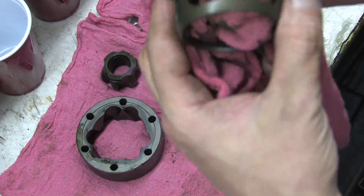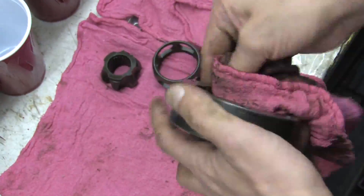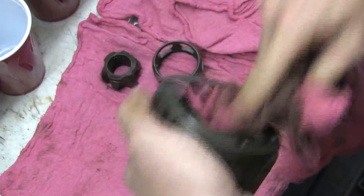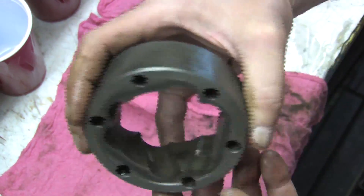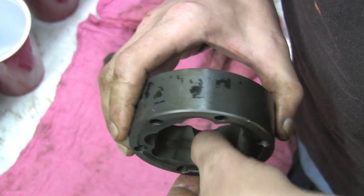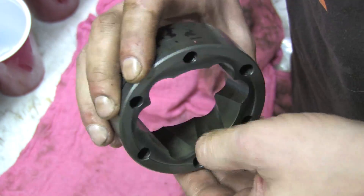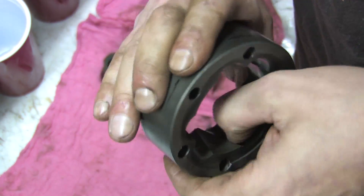If you're in here because the boot is ripped, that means moisture and dirt easily get in — and that's this part's number one enemy. If it's rusted, scratched, or pitted, you'll need to replace it. The Volkswagen and Porsche joints are about $50 each and the boots are less than $10. Mitsubishi contracted these parts from Lobro, so it's clear they didn't feel like re-engineering the wheel — they already had something that worked.